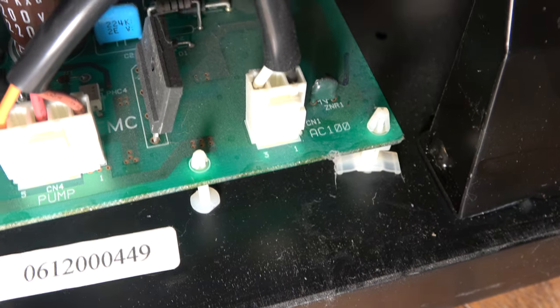The fault is somewhere on here. I mean, maybe I can find out where the fault is by looking at how low the resistance is across the 5 volt rail as I go through the various tracks. But if it's almost any IC on here, I'm going to be stuffed. But, you know, let's persevere. I could really use a thermal imaging camera here because I could put 5 volts on and see what gets hot. But I don't have one. So let's do some investigations.